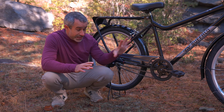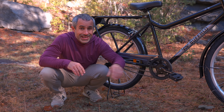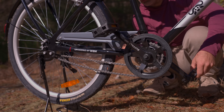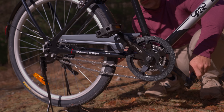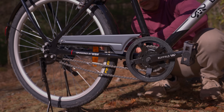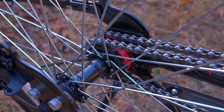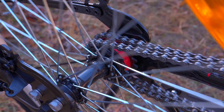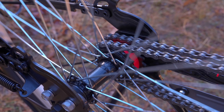If you want to shift between either of these two gears, you simply kick the cranks back and start pedaling — it's that simple. But you'll notice that regardless of what gear we're in, both of these chains continue moving, because they're both attached to the same fixed crankset. All the work is happening back here at the freewheel.